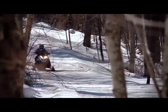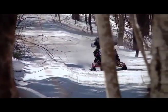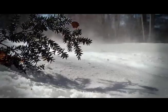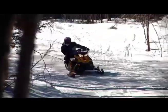The advantages the split rail ski yields in cornering performance are numerous, but the most easy to describe advantage comes from this reaction to having a split ski or two rails on the ground. And it's when you turn deep into a corner with lots of speed behind the snowmobile, the split rail ski does not try to climb up on top of the snow. Because you've spread the weight over two separate rails and you have two carbides biting, the ski tends to cut down in the snow rather than ride up like a conventional ski.